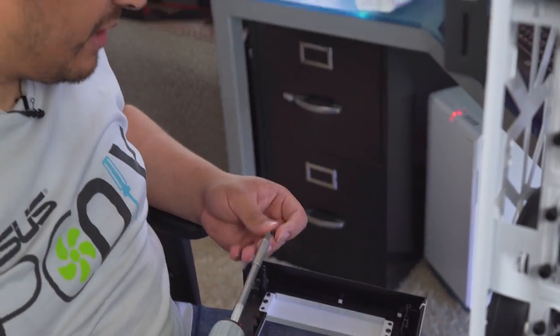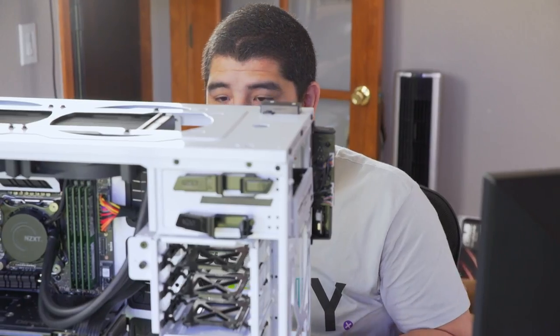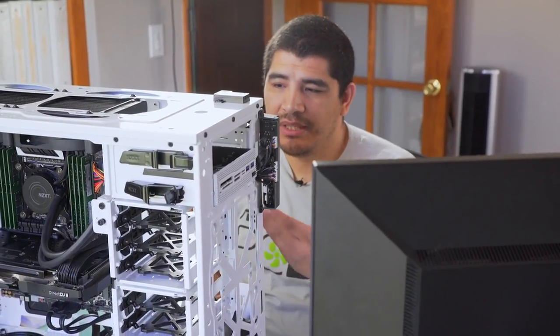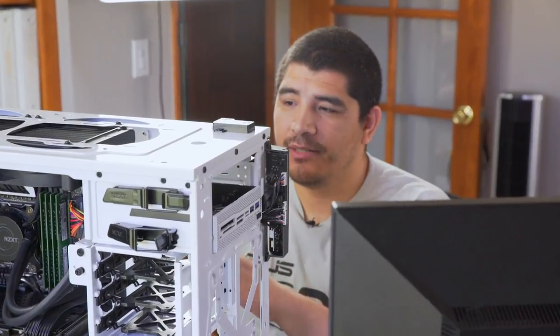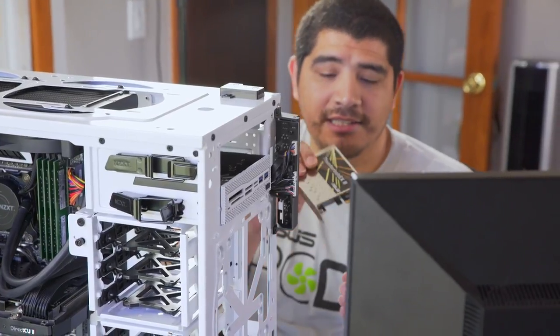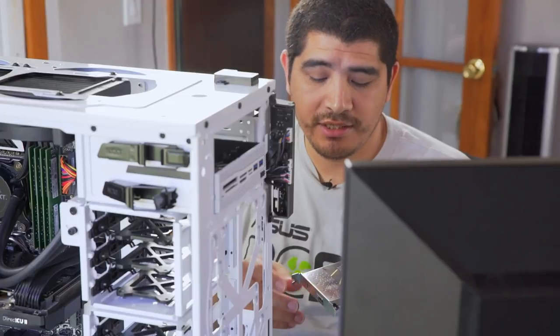On the rare occasion that I needed to use Thunderbolt, I wanted to know if this build would have access to Thunderbolt capabilities. Thunderbolt actually came out after the original advent of X79, but it couldn't be easily added in because there were chipset requirements. But for this X99 chipset versus the X79 chipset, you will be able on any Asus board to add in Thunderbolt. So we've got this little card, and we'll show you guys how it connects specifically once we incorporate it into the build.